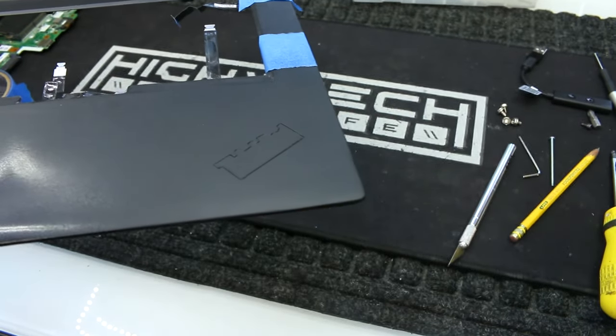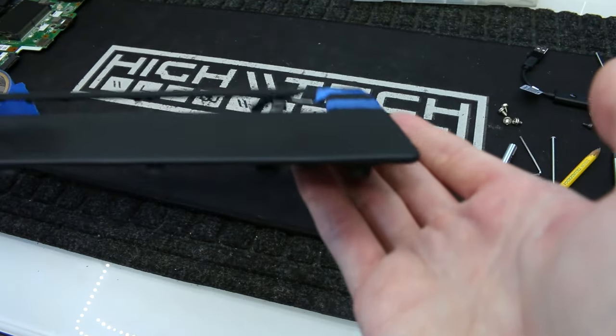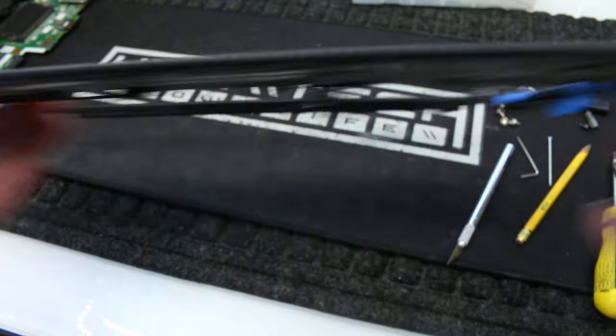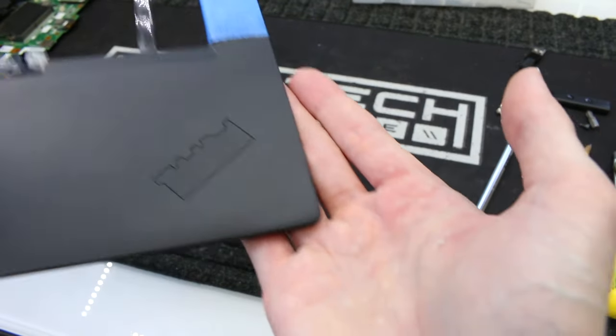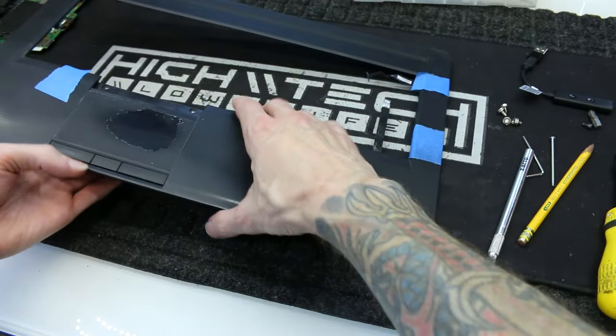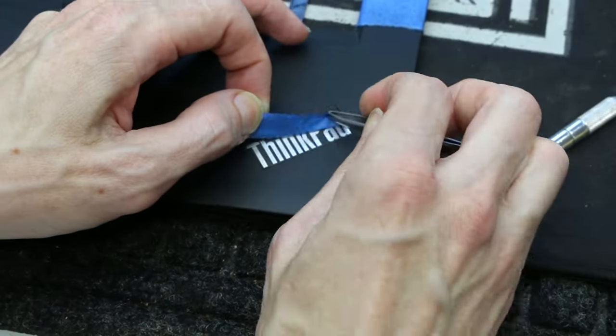Here are the results from our repair and it looks very good, though it is not perfect. There are some slight little wobbles when the light hits it just right. As I stressed earlier, the more time and energy you put into sanding and making things smooth, the better the end result is going to be. Mine is not perfect — there are slight wobbles where the Bondo is not perfectly flat. However, from about a foot away it looks pretty good. The paint is not an exact match, especially on worn parts, so if you only paint one area it will be noticeable. Although it is not perfect, it definitely looks worlds better than having a big crack or chip missing.